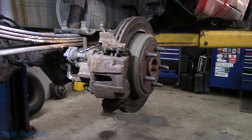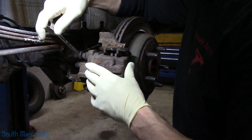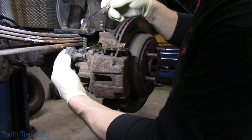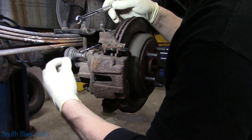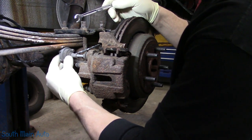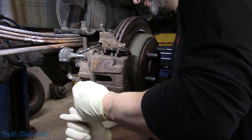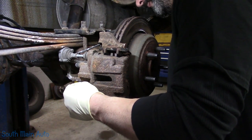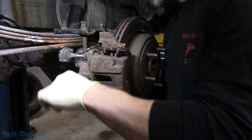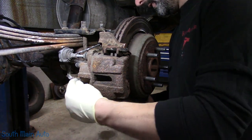I've got a bunch of tools and stuff here on my cart, so it's going to be a little wiggly and jiggly. We're going to take the little dampener slash upper caliper bolt out. Sometimes these things are a real pisser to get out — a lot of times you can't get them loose with just a wrench. You get a little pair of vise grips or something on there and crack them loose. There's a little noise suppressor; it won't clear the spring so we'll leave it in.